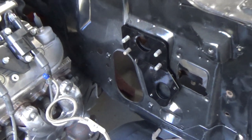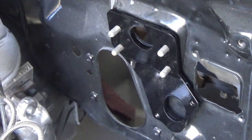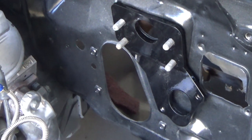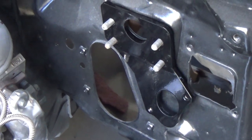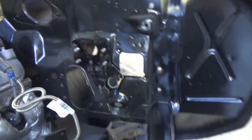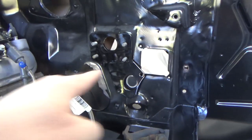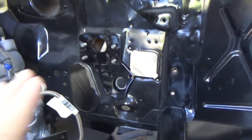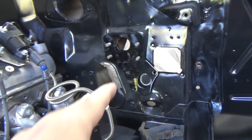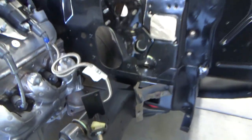So I forgot to put on the clutch master cylinder bracket — we've got that on there now. We'll figure out where we need to drill the hole for the clutch rod. So we're trying to eyeball where this push rod is going to want to go through the firewall. I just took a sharpie and marked where that position is. It comes up at a pretty steep angle, about 45 degrees. We're going to try cutting a hole lined up with the top of that thing and see how it works.